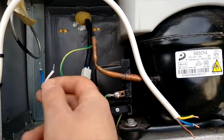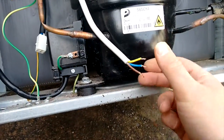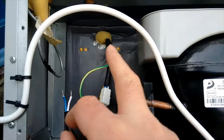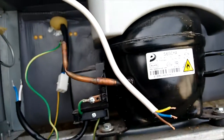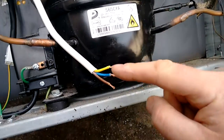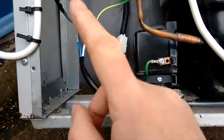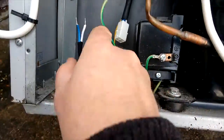That's neutral, that's live, and this is new cable I'm going to wire onto this here. I've actually overridden some of the main wires which come from the inside things for the door and the old thermostat - all that's gone. What I'm going to do now is wire this to that with some junction boxes, and I'm just going to solder these ends up the same as that there.